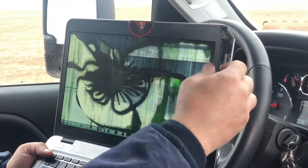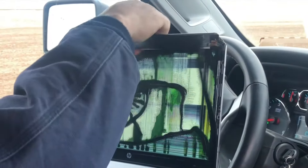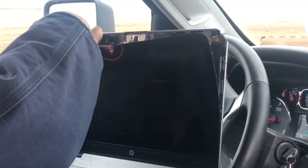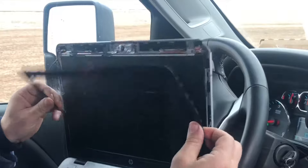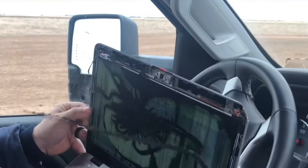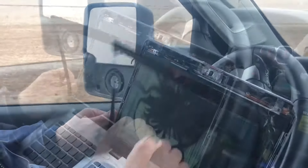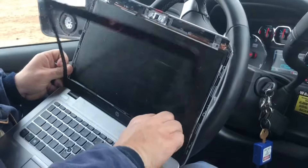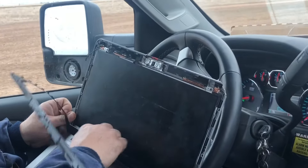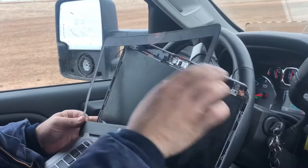So this happened at work to me and I already ordered the screen and everything. What you're going to want to do is pull this plastic cover off the edges, and it's going to be like this for the majority of computers. Sometimes they're glued down pretty good so you've got to pry a little bit. But if your LCD is already damaged, you can pull a little bit hard and not feel so bad about it. Down here at the bottom, sometimes it's pretty sticky and sometimes it doesn't come up just right, but just keep at it.